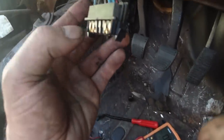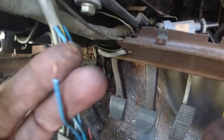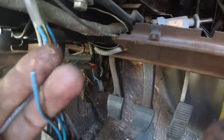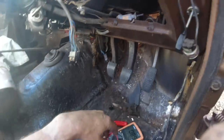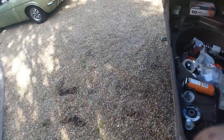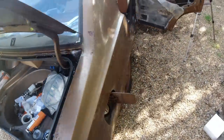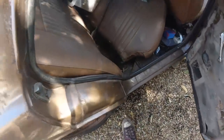So I thought it might have been a bad pin here. So I just spliced in, cut in. This wire should be short to ground because I'm grounding at the sender. So that should be ground. Ground at the sender should be ground here. There isn't anything, which the only explanation is there's a break in the cable. There's no other explanation because you grounded there on the plug. Just shorted the plug together. Tested the ground connection, it's right. So somewhere between that and the dash is a break, and indeed lift the seat and what do you get?